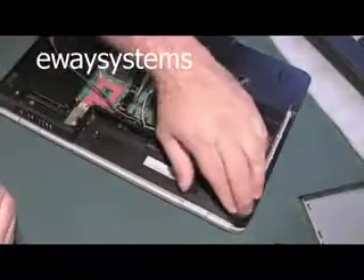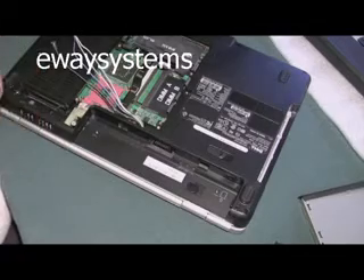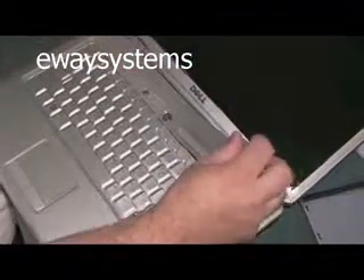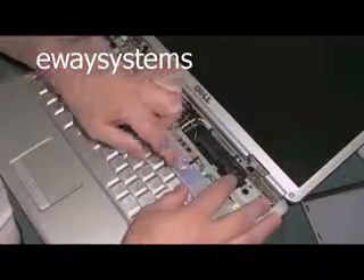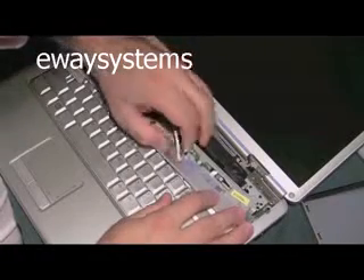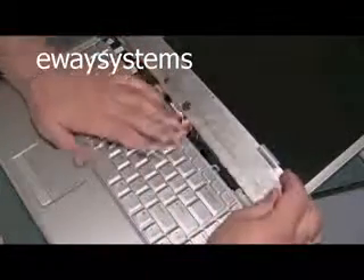Since we're down here and I want to get the hinge cover plate off, let's take these two screws off because these might be holding it on too. We're going to have to take them out anyway at some point. Now I have those four screws out — there should be nothing holding this hinge cover plate on now. Put a little pressure here and it comes out much easier, so yes, those screws were holding it in. You just got to jiggle it and it will come out. Be careful — the new Dells have this new touch panel here, so there's going to be a ribbon cable attached to it. I'll put that back in for now; it might be easier to detach from the motherboard.